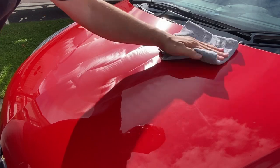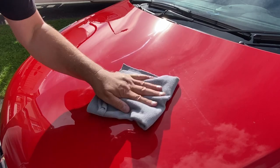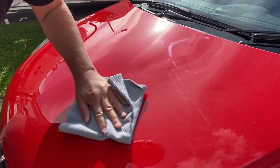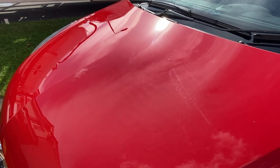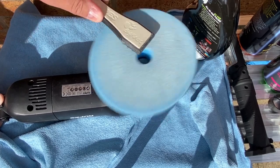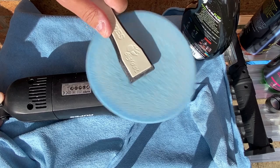So how does an all-in-one polish work? When you first feel the polish between your fingers it's quite gritty - this provides the cutting of the oxidized layer, hopefully removing swirl marks and holograms. As you work the polish with the machine, the abrasives diminish down, finishing off the paint to a smoother look. Resin fillers can also fill deeper scratches for a more refined look, then the last step works in protection - though this is never as good as a direct application of wax or ceramic coating, which is a weak point of these polishes. The major benefit to the enthusiast is speed and ease of use. Rupes have a simple cleaning tool with bristles and a rubber wave design - you turn the machine on and work it over the pad until clean.